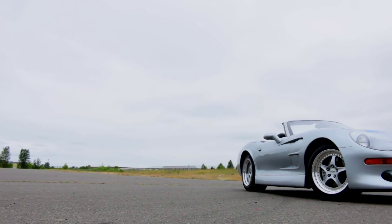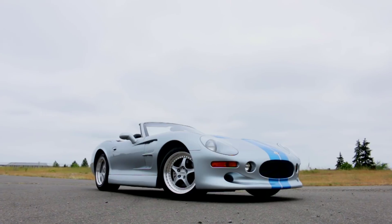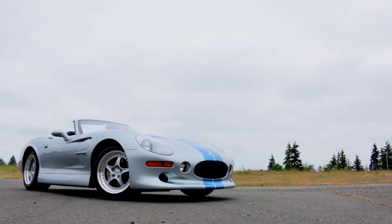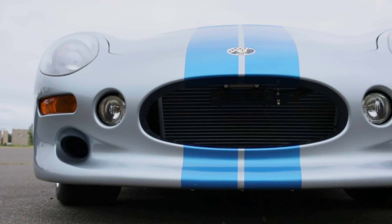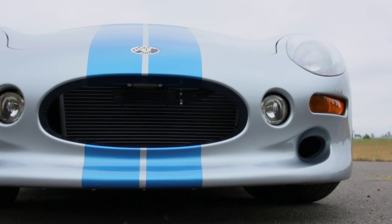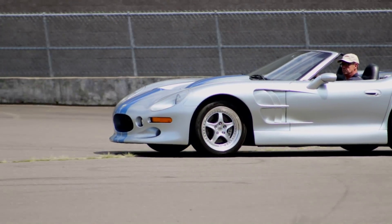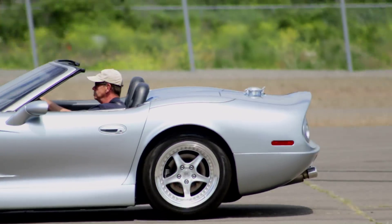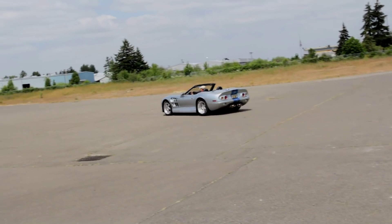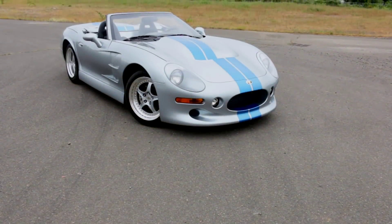The Series 1 began with a full aluminum chassis consisting of welded rails and formed sheets, which was heat treated after welding to enhance the rigidity. Floors were a honeycomb aluminum and carbon fiber composite, which was also lightweight and very strong. Back then, automakers were tossing around resonance statistics to articulate chassis stiffness, and the Series 1 was advertised with a high 52 hertz resonance frequency, far more rigid than most other cars.